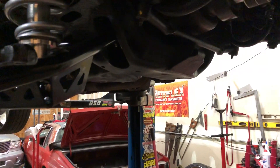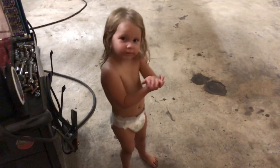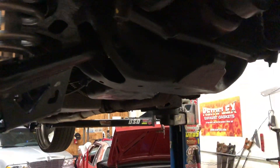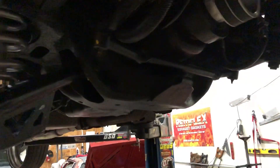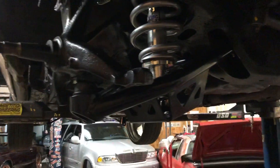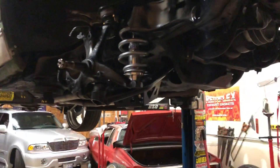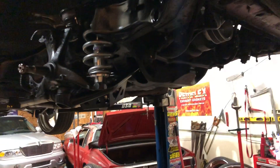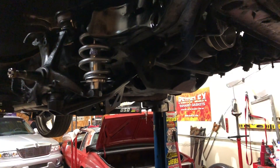The tie rods that I had on here hanging — they didn't fit and I couldn't figure out what was going on. I noticed it wasn't fitting in the center link too good, but the bolts still went on. We were trying to get it in the spindle today and obviously the thing is they were Dodge tie rods. Somehow when I ordered tie rods I ended up with some Dodge ones — like for a '71 or similar. So now tomorrow I've got to get another set of tie rods for the correct application.